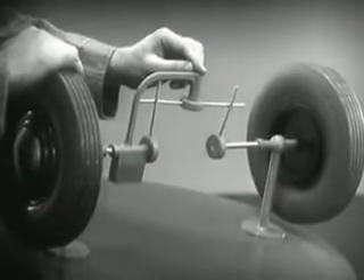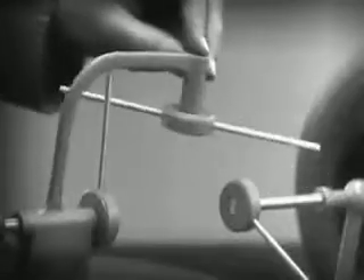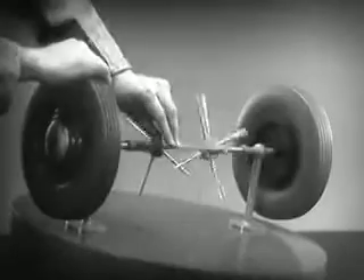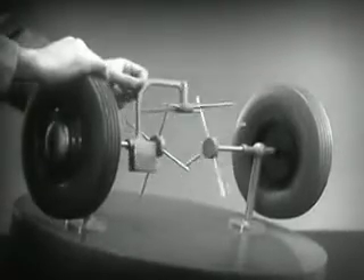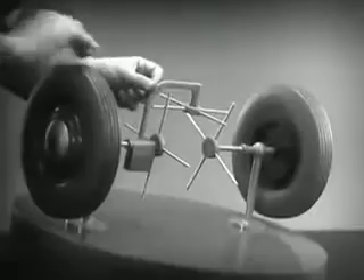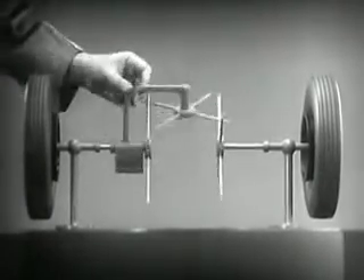But if turned too far, the bar will swing around until it won't drive the spokes that turn either wheel. We need another crossbar and more spokes to carry on the job. When we stop one wheel, the crossbars will continue to push the spokes of the freewheel around. As long as both wheels are free to turn, the bars do not swing on their pivot, and the wheels move at the same speed.